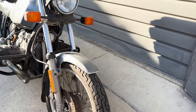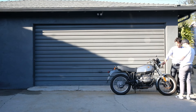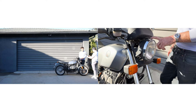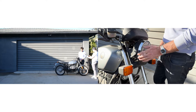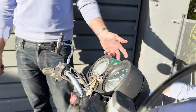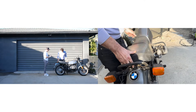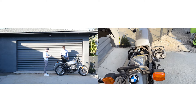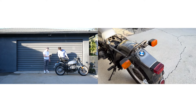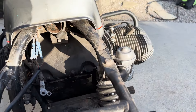On the ST, this is the later Bosch H4 headlight — lens and reflector — and we can use that on a slash 5, so lovely upgrade. Is there anything under the saddle? Let's have a look. It's been pillaged. There should be a tool tray and tool kit, and a donut battery. Look at all the splicing in that harness — you want to ride that bike? I think not.